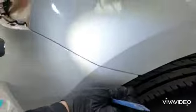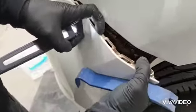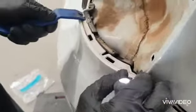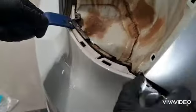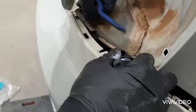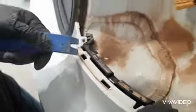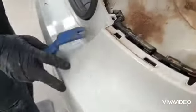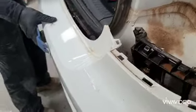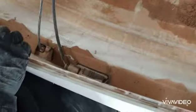We're going to come up to the top of the bar. Like we did on the other side, gently pry your bumper off this bracket, and the same with this side - you want to give that a little bit of tension and give that a little pull. Gently remove that. Then you might want to grab your colleague, friend, wife or husband at home, and easily just pull this off. Now what you'll see is it's got a camera for your rear parking sensors.